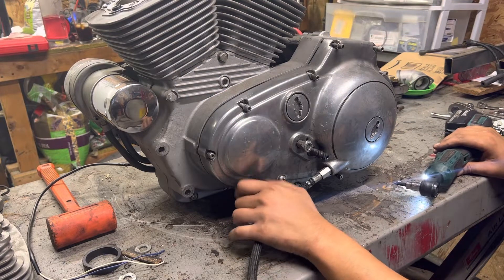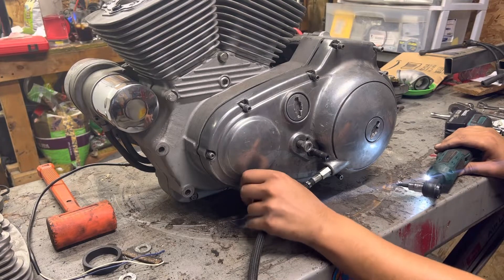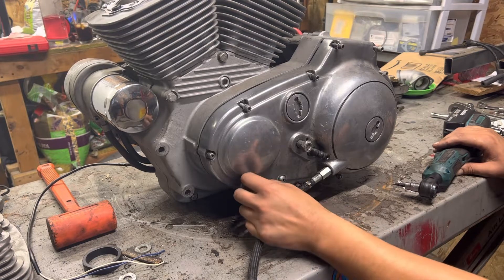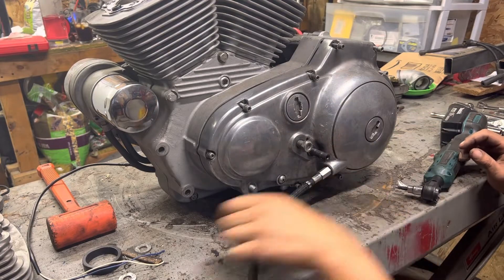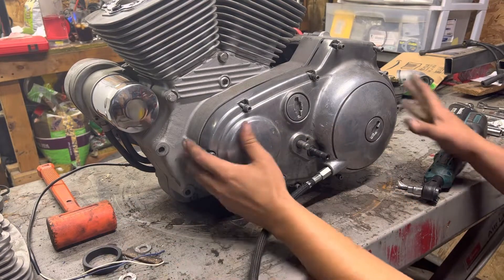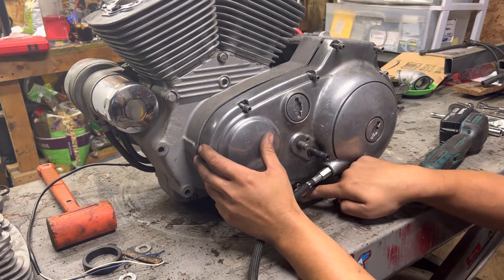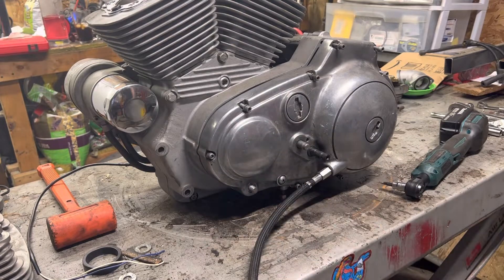You've got your one through-bolt slash nut at the very bottom front. I think this may have changed on some of the newer ones, but on the earlier Evos it's a through-bolt. I've got to pull this one off too for your foot peg mount. Let me block this up — your primary chain tensioner adjuster stud is sitting on that, so I've got to throw a block of wood underneath there.